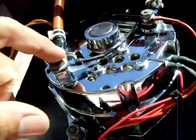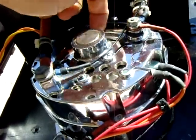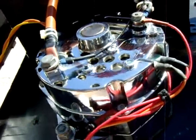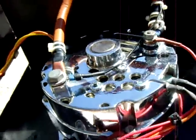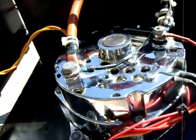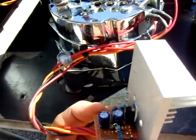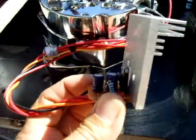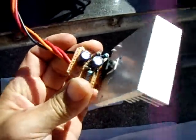There are fewer parts on the inside to deal with now — just the brushes with the diode trio and the rectifier. Output voltage is around 14.8V max. I ran it at 8 amps straight and it kept up the voltage just fine, so I'm very happy with it. If you're looking for an external voltage regulator circuit, I got this from chemelec.com — c-h-e-m-e-l-e-c dot com. He's a really nice Canadian guy; I actually spoke to him on the phone. Go visit his website — I'll put a link so you can build your own external voltage regulator.